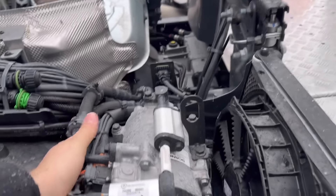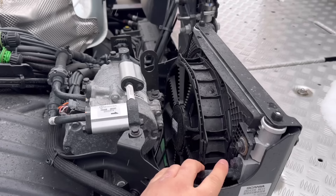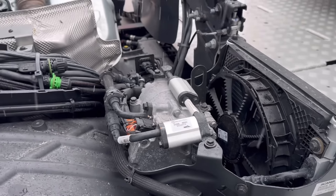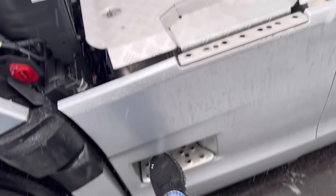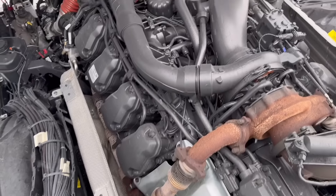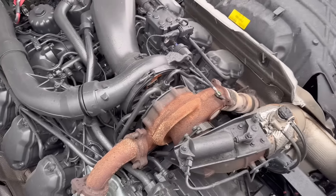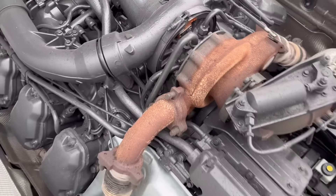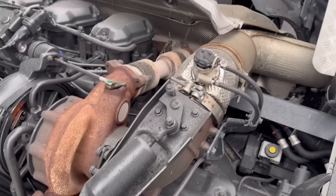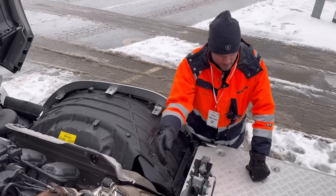I think this is the heater — we call this the Webasto heater. Does it also cool the truck? You can choose — it's an option if you want cooling, so for the summer days you can have cold air. Looks like a mini AC condenser going right there. And we do have a service step here; you can step up on the deck back here. This is the new big transmission on this one compared to the older style. Just a monster of an engine right there. This is a non-VGT turbo — fixed geometry turbo. Looks like it's got an exhaust brake right there, and a regular old wastegate. Looks like our DEF injector right there. That's the SCR system — this has a twin SCR. The AdBlue first injection is here, and the second of course is here in the aftertreatment.